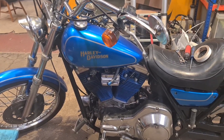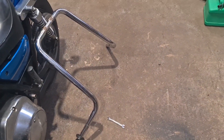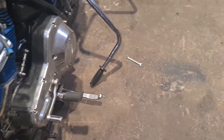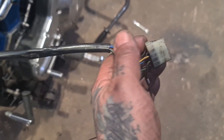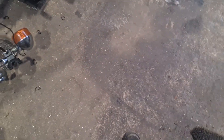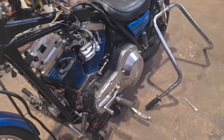The plot thickens. I'll come round the other side — we've got the switchgear off, no worries. Those handlebars are drilled, not notched, so they should have internal wiring, which is going to be an absolute pain to do. I'm going to have to work out how much longer this loom needs to be, then splice into it, somehow feed it through the bars. I don't know how I'm going to do the indicator wires because there's absolutely no provision for running them internally. Fucking stupid things anyway.